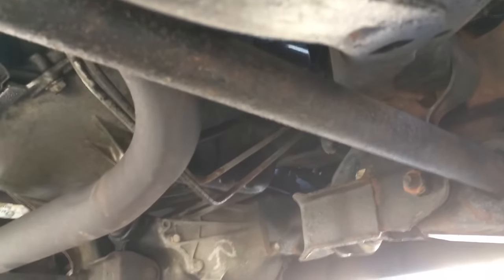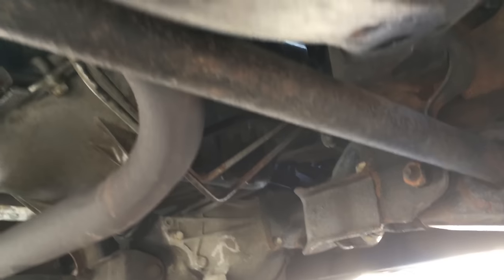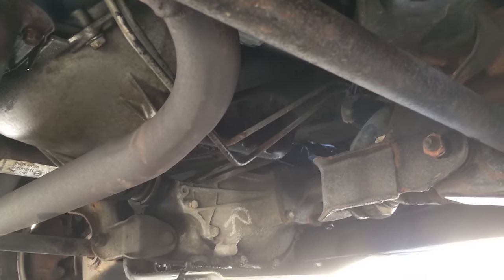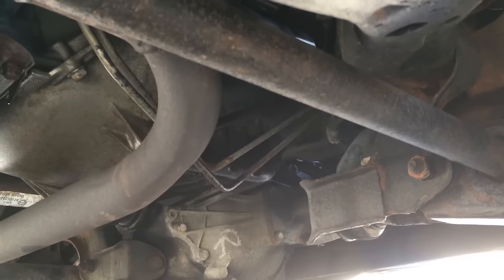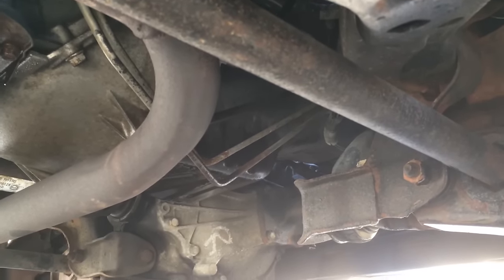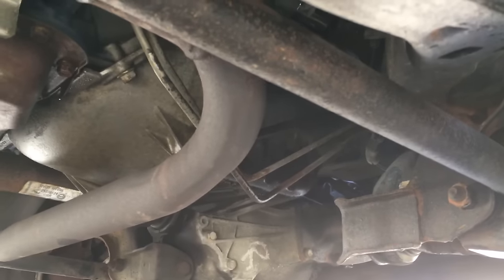The other thing that happens on these engines as they age is sometimes they'll smoke on startup — just blow a ton of smoke out the back — because oil seeps in through the head and gets into the cylinders. But it only happens sometimes, and after a minute the smoke is gone and it doesn't do any damage. It'll run forever like that. It's just kind of embarrassing when people see it happen, especially the Ford guys.